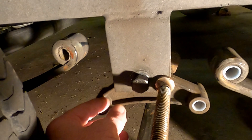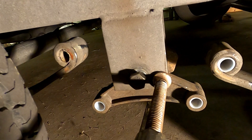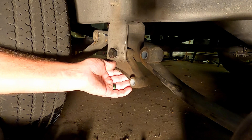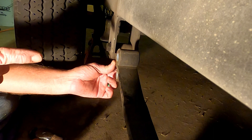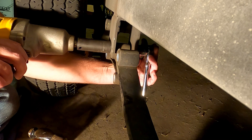I'm getting ready to put it back together, but the problem is the U-bracket here is spread too far apart - I can't get a nut on the back of the bolt. So what I'm gonna do is just c-clamp it, squeeze her a little bit and get her back in place. I've got a little play in between there. I checked the other side which came from the factory and theirs is just snug, so I'm gonna go ahead and keep tightening this one up.